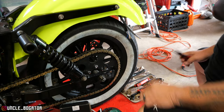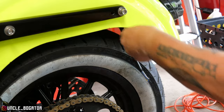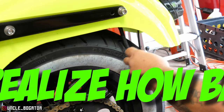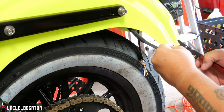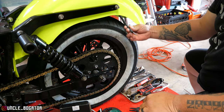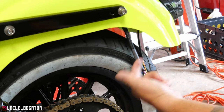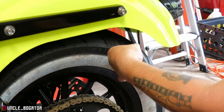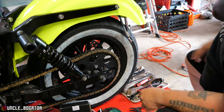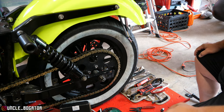We're actually on the second day here of working on this. My soldering irons are both a little shoddy so I went to Harbor Freight and got a new soldering iron and some 5/16 heat shrink. I pre-positioned a little piece on here and a larger piece so I can close those up when I'm done. I was going to put the 5/16 all the way through, but I can feel the splices from where they changed the wiring — that's going to be important in a bit. At the pin connector the wires are a different color, so we're going to have to figure that out.